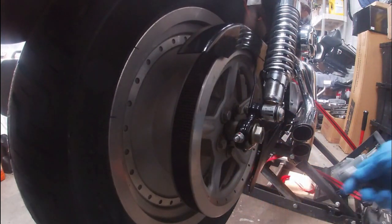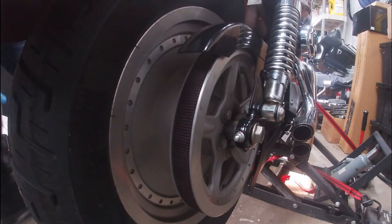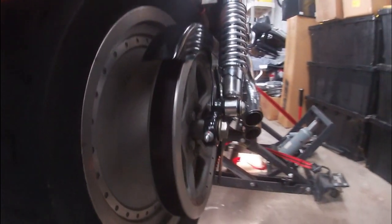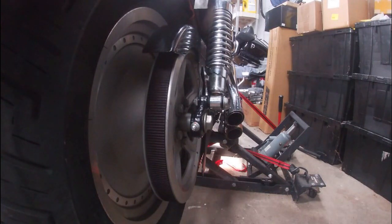One thing I should buy is a belt alignment tool adjuster — I don't really do this enough to require it. Next order of business is going to be this bottom shock nut and bolt. We'll see if we can get this broken free; these are only about 45 foot pounds if I remember correctly. You do need a three-quarter wrench and a T50.